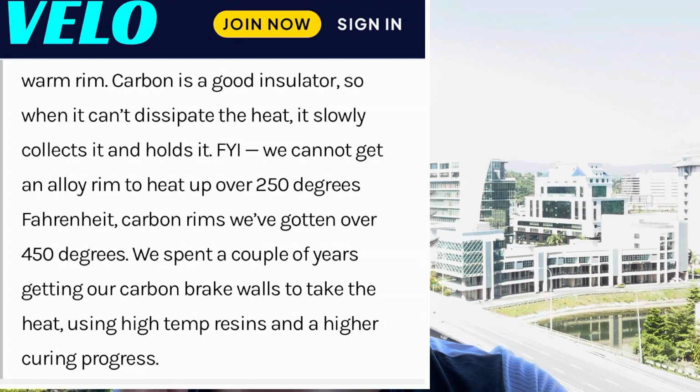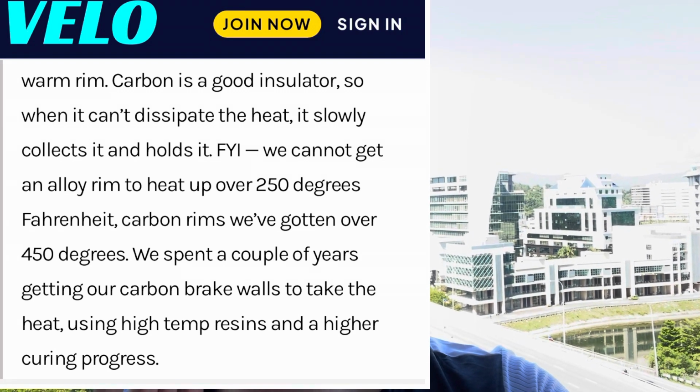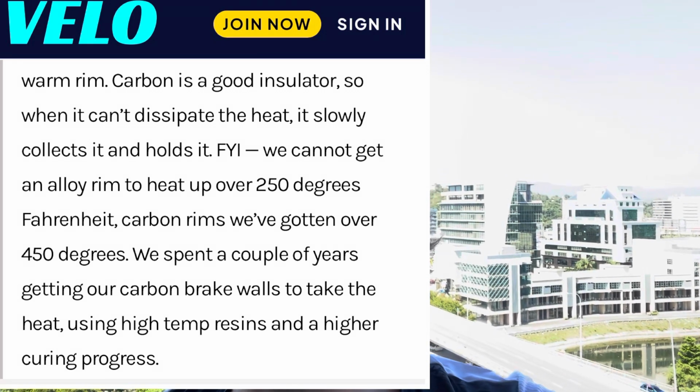because I find the hydraulic braking of disc brakes feels like a disconnect between the caliper and the trigger and my hand, you know. Whereas with rim brakes, I feel that direct contact with the cable pulling against the pads, and the feedback is really useful to me. It tells me how hard I'm braking, and it allows you to communicate with the wheels and prevent yourself from overdoing it, basically. And they cooled down very quickly. Like I say, I started that previous video immediately after pulling over, and within a matter of seconds they were cool enough that I could touch them with my bare hand. I would say around 40 degrees, maybe less. So way lower than the 300 or 400 degree Celsius temperature that they're supposed to melt at, which is very reassuring.